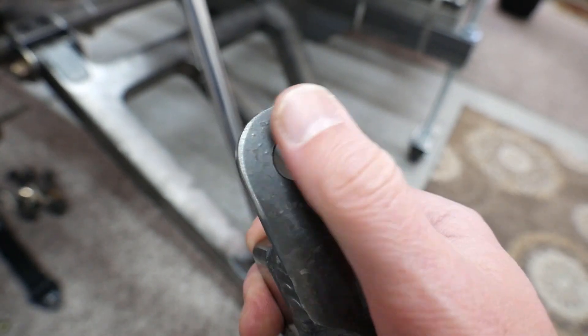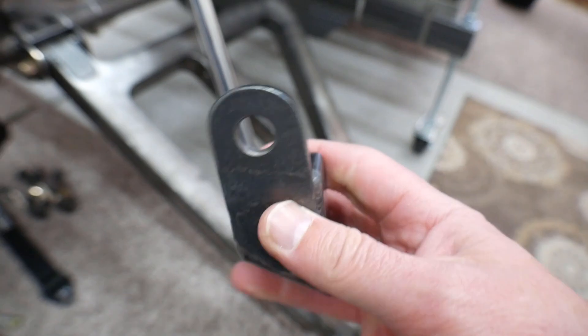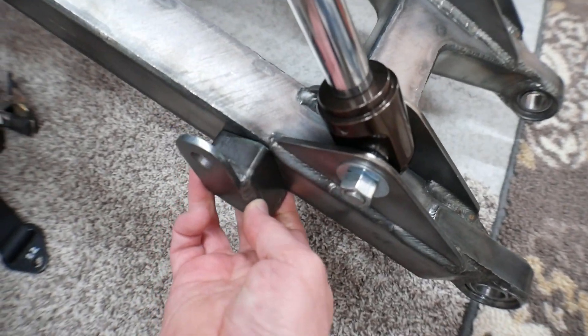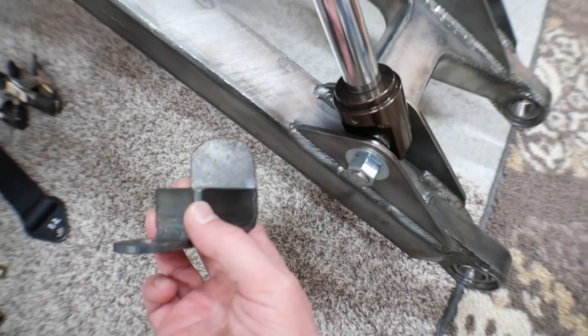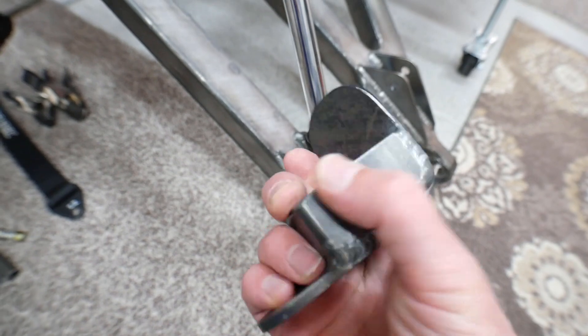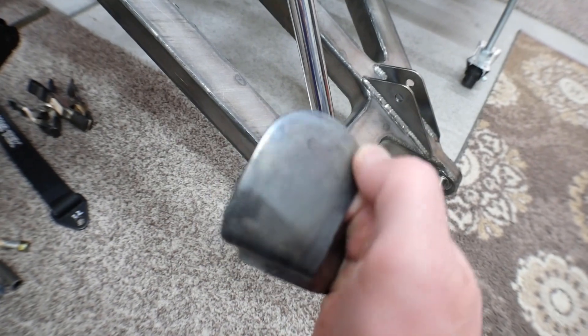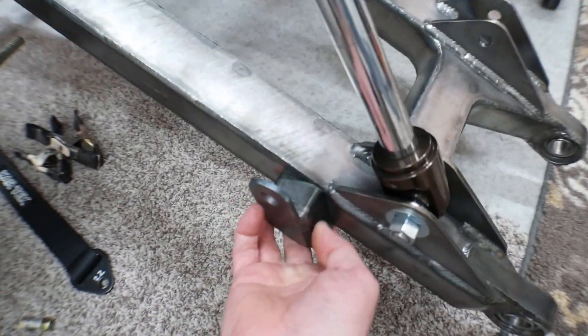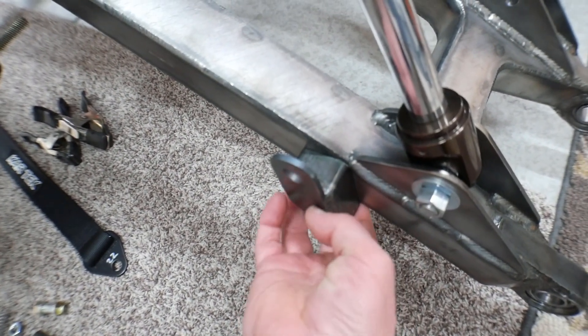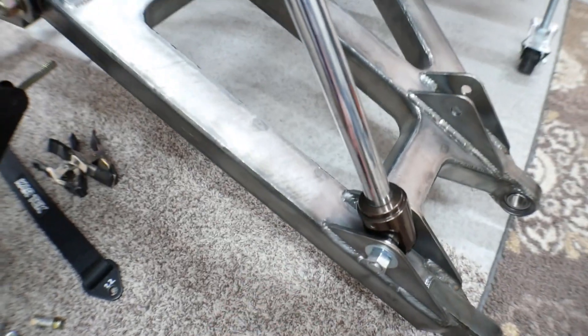This piece on the outside is three-sixteenths, just so it's nice and thick for the strap to actually bolt to. This will get welded on here, and I'm going to MIG weld up the sides and across the top, and then TIG weld this piece across the bottom. That's all set up and ready to go, so I'm going to take this over to the table, weld it up, and then we can move on to the top.